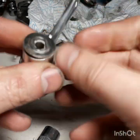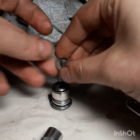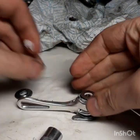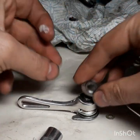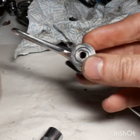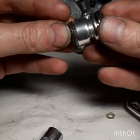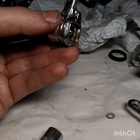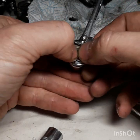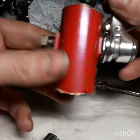All you have to do then is put this little keyed washer on — it goes on like that — and then there are washers that go on. There's a washer that goes on before the keyed washer, then that goes on there, then finally this little thimble, and then the screw goes through. Unlike Shimano shifters, these actually have a little retaining washer which is nylon, and it goes on over the screw. It's all held together by tension with the braze-on and plate.